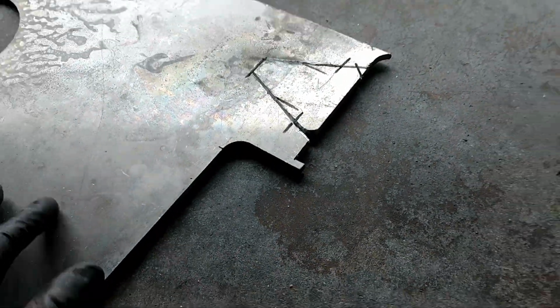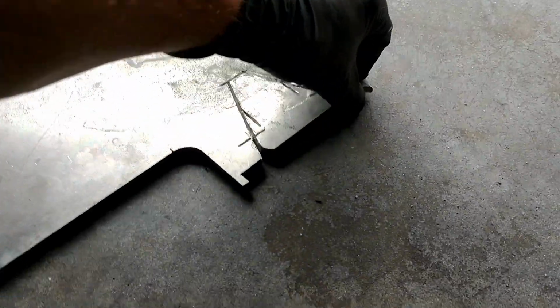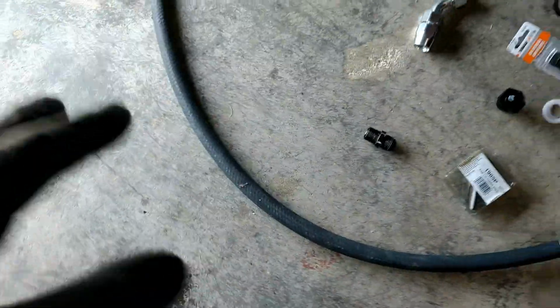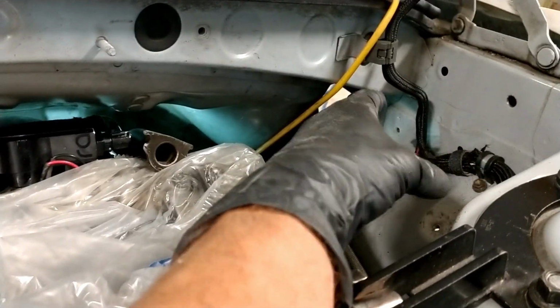On the bottom of the crankcase vent tube, however, what I wanted to do was create a plate, which you can see here. I'm starting to cut it out. It doesn't take much, just a Dremel. I'm cutting up this material, which is a lot thicker, because I'm going to be threading in this AN fitting and then this line right here, and have this independent and go to its own catch can system that I'll put over here in the corner where the ventilation is.